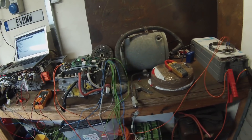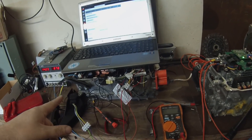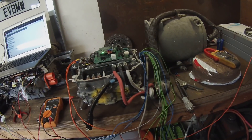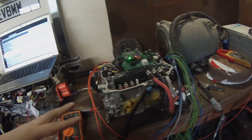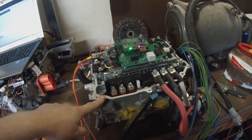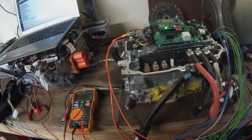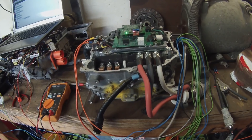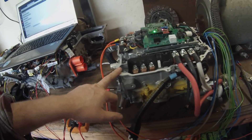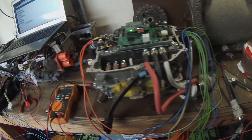Now that we have that solved, we can run these ANOVA motors. With two of them, we're going to need two inverters. I went round in rings on this — I considered Prius inverters, a Siemens inverter, a whole bunch of things. But the timeframe on the Range Rover has accelerated slightly. So I had this baby hanging around: an inverter-converter from a 2015 Lexus IS 300h hybrid. This unit has not one but two three-phase inverters in there.